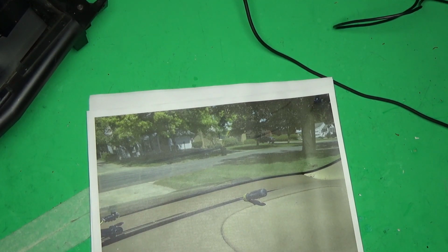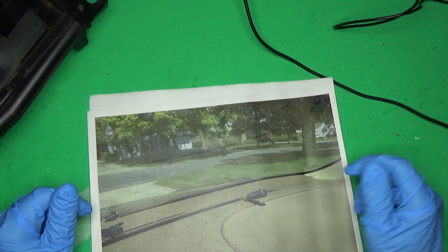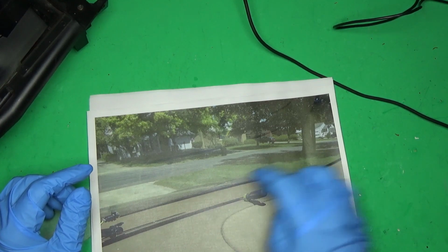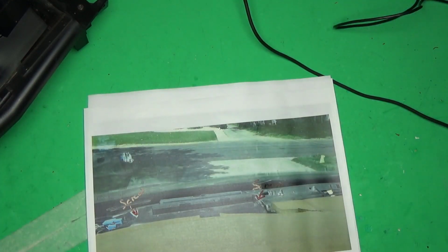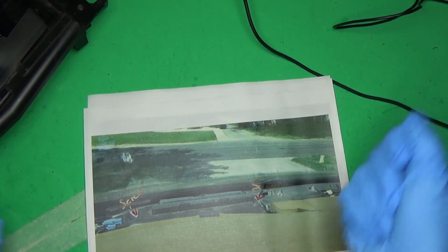And then this is where people are going to yell at me, but I just use flathead screwdrivers and pop the trim off. There are actual proper trim pieces or trim removers. If you have some kind of long plastic piece, it'd probably be the best because it wouldn't damage the plastic of the dash. But I was careful and was able to just pop it all loose. Once you get it loose, you can take it off. You've got to really pull on it and play around.